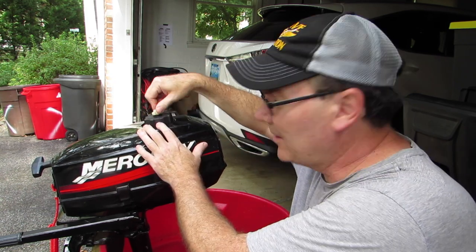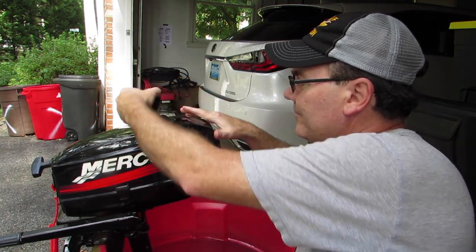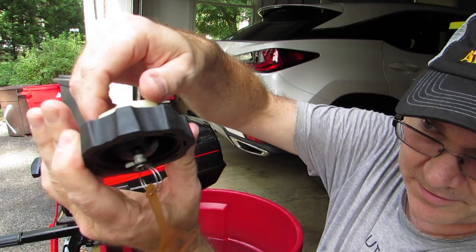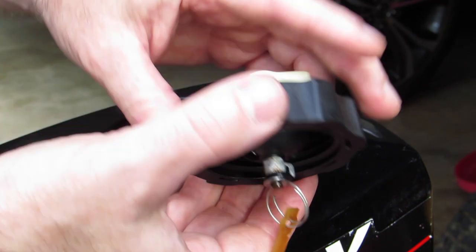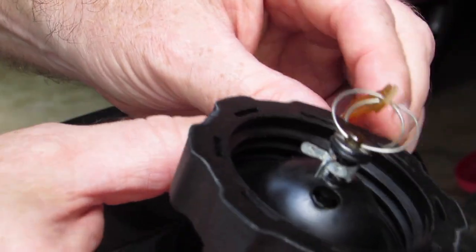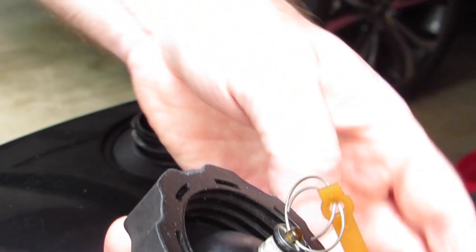Here's how I figured it out. Today, when I went to loosen the vent cap, I decided to first take off the fuel cap. As I took it off, I looked at what was underneath for the vent. When you turn it, it actually winds a stopper up toward the cap. Without taking the fuel cap apart, I often thought it was very simple — that loosening it just opens a hole going right into the tank letting air through. But it's a little bit more complicated than that, because it's got a valve in there that allows air to come in.